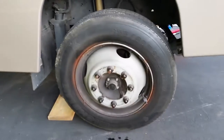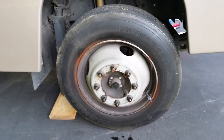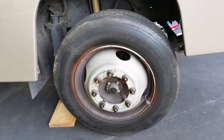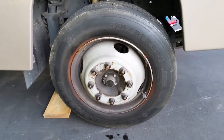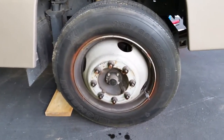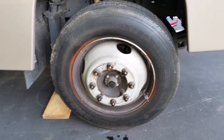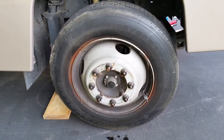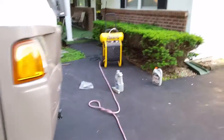Today's project is rotating tires and flushing the brakes — not so much bleeding, just getting out the old brake fluid so I can push in new and keep the moisture out, keep the rust out of the brake calipers so we don't have any sticking problems. I do this in my driveway. I've got a small air compressor.